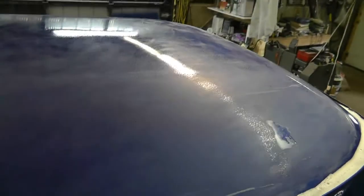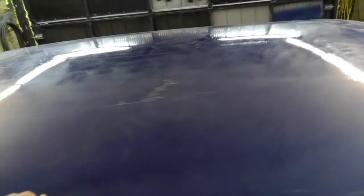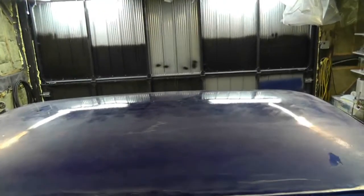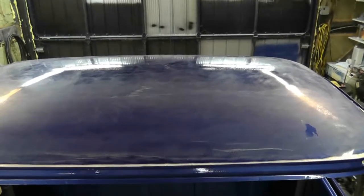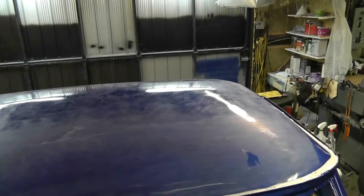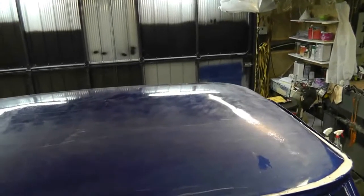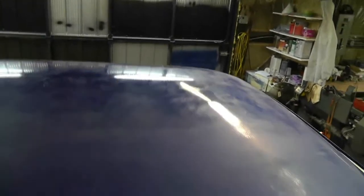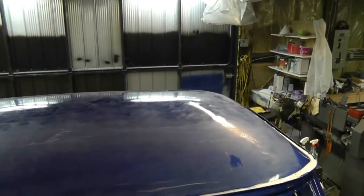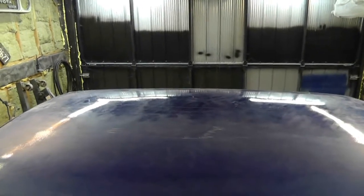But I'm getting closer. I'm really seriously starting to think that I should have started with the 1500, but I don't really want to move to it now, because then I have to work my way right back up to 2000, which is, I guess, 1500 then 2000, but whatever. I might start on the back half with some 1000 actually, and try to take that down a bit, because you can see just how orange peely it is. It's very fine orange peel, and that seems to be taking a long time to do. So anyways, I'm going to get back to it.